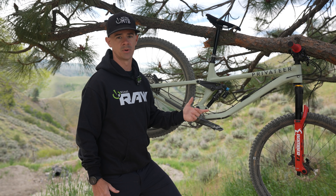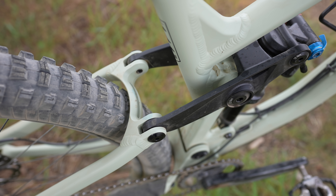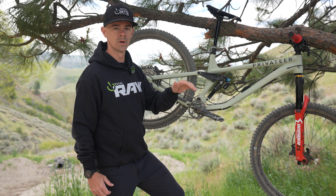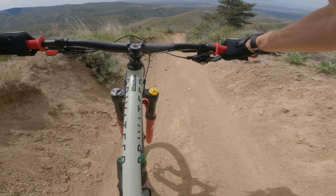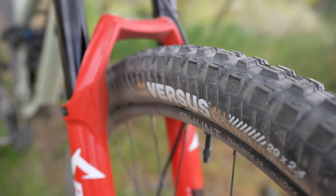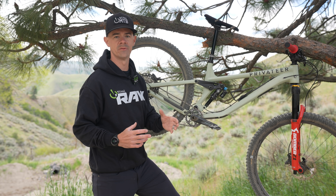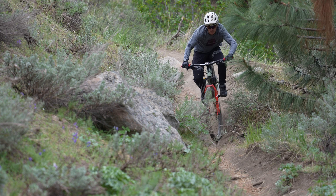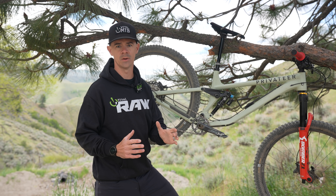This thing holds its own against pretty much any bike out there. The four-bar horst-link suspension delivers a really nice feel at 30% sag — the bike tracked extremely well, and while we found bottom when it mattered, we weren't consistently slamming through, meaning we had suspension left when things got really nasty. The Hunt Trail Wide 30 wheels gave a nice profile and feel. A 2.4-inch tire like our Versus is just enough meat to track through the rough stuff without creating a vague feeling. Our Marzocchi Z1 proved once again to be a top performer — 36-mil stanchions, 150 mils of travel, nice mid-stroke support, and a smooth buttery feel on trail. All of this worked in concert to deliver a bike we felt was as well-rounded as anything we've ridden in this category.